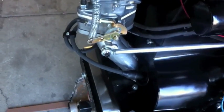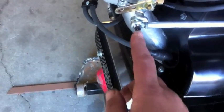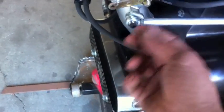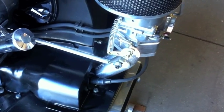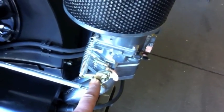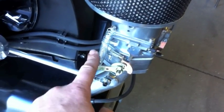I wanted to explain how to adjust this end to where you can get that screw in. We start on the other side and set the stopper over there. This linkage has a left-hand thread and a right-hand thread on the tie rod, so when you take these nuts loose, the linkage will swivel in and out, making it expand and contract — that's how you get that screw to line up exactly with that hole. There are two holes for the spring tabs: generally we put the springs on the inner hole rather than the outer hole. If you need more tension, put the spring tab on the outer hole; if you need less tension, put it on the inner hole.